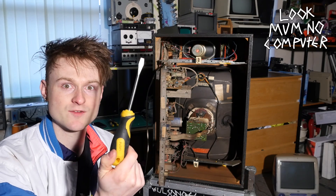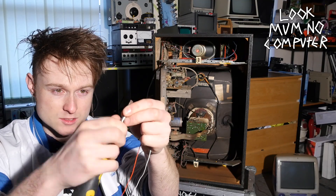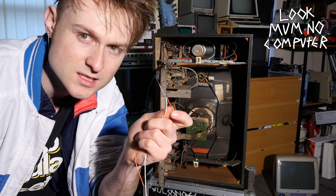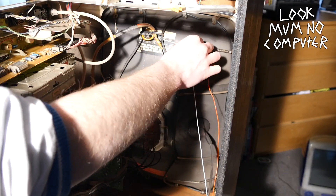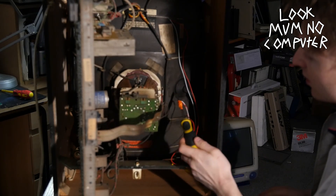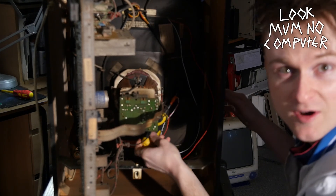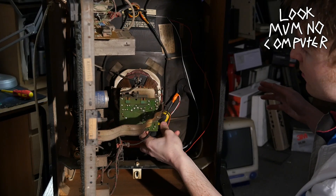What I'm using is a relatively short screwdriver and some wire. I'm wrapping the wire around the screwdriver like that. This end, we've got to attach it to the ground of the chassis somewhere. Step two is you find the rubber plunger that is on the back of the CRT screen, poke the thing between it. You might hear a couple of pops and crackles — that would be the TV discharging a large amount.